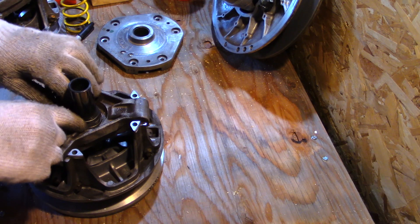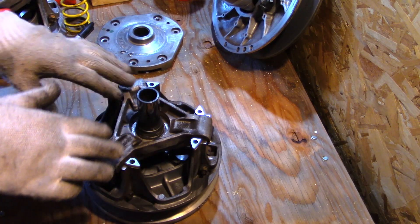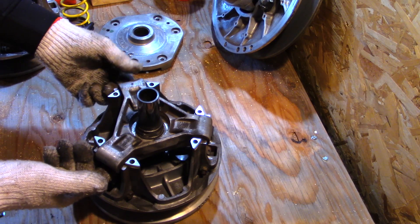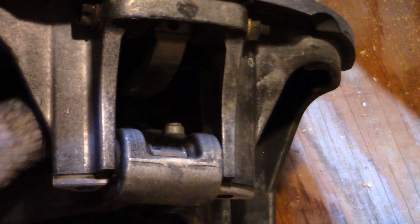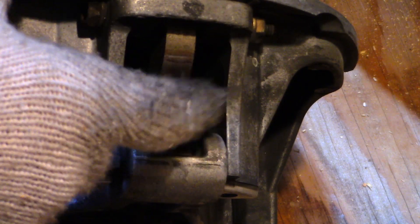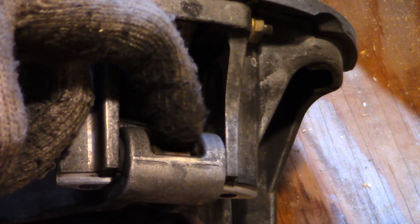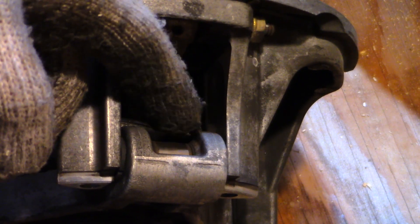The spider looks to be in good shape — it doesn't look like anything's actually wrong with the spider itself. I think this one just got dirty and I wasn't on top of it the way I should be. The weight springs up nicely — it's in good shape with a little bit of grooving, but really minor, not worried about that. Another roller here has a little bit of play — pretty minor. That one's actually not in bad shape; it does have a little scuffing at one point but overall the side-to-side play is pretty normal, and it's rolling just fine.